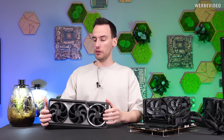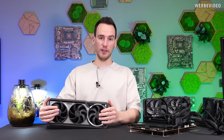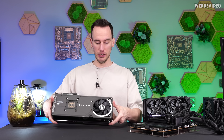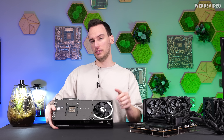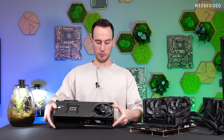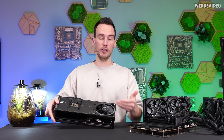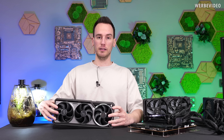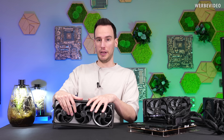In the first video I explained how the fans work together and how you can manually adjust the fan curves. We saw that the left fan and the right fan were working together combined, and also the middle fan and the rear fan. The rear fan was the main source for the annoying noise being generated. And we showed that it would be ideal to run the rear fan at maybe 500 to 600 RPM, while the front fans spin a little faster — the thermals would then be pretty nice and the noise level great.